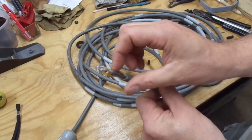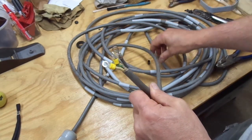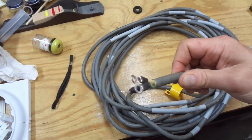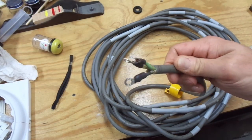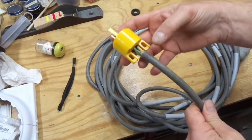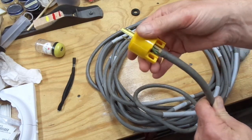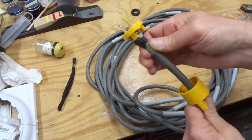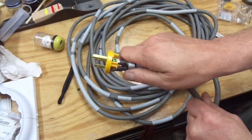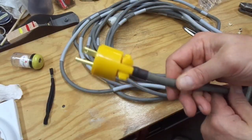So there's one of the wires. I took the yellow plastic collar off it - these plastic pieces are a little too beefy for the amount of space I have inside the plug. I'm going to instead use a piece of heat shrink tubing. And there are the three connectors now, all dressed with heat shrink tubing. And here are the three conductors screwed onto the plug, and that fits in like so. I'm going to put a little heat shrink down in this area. This gray is probably supposed to be up here by the clamp, but if you do that it doesn't give you very much room at all. So I reassembled the plug with three pieces of heat shrink tubing up here, and here are the three pieces shrunk on, and that's going to go on like so. And there it is all assembled.